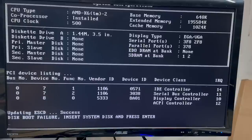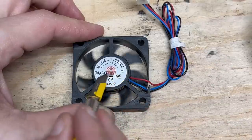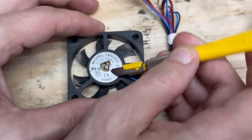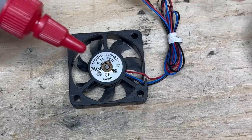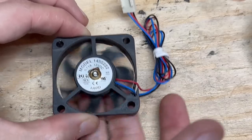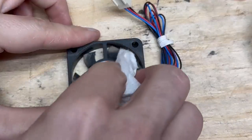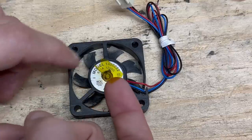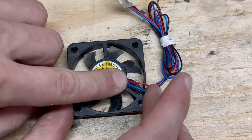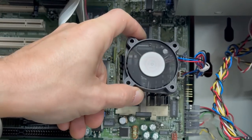It is not happy about that floppy drive. It sounds like that CPU fan is just getting worse and worse — I'd better give that some attention. So I'm just going to cut into the label to get at the bearing, give it a little drop of oil, work that in, take up the excess, give it a quick wipe down with some IPA, and then seal it up with some Kapton tape. Much better — I can barely hear it now.